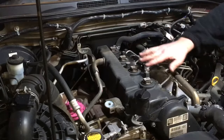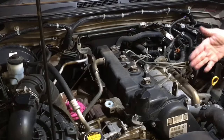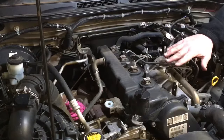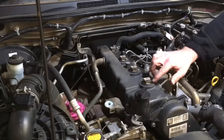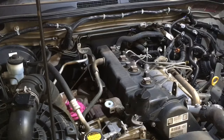They don't usually leak. I'll put it out there actually, so that's not included in the kit, and it's not a normal replacement part. As I said, they don't leak. The only time they leak is if you don't clean this cover, and there's dirt and debris underneath that seal, a little speck of sand or whatever. It's enough to hold the seal down a little bit. It's like a double seal, and then it'll just sweat. It won't leak, it'll just sweat, it'll be untidy.